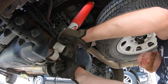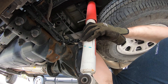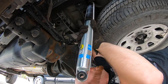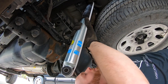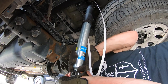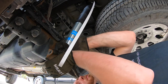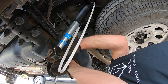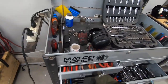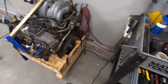The back shocks are super simple — they're just two bolts: one on the bottom that has a nut and bolt, and the one on the top you don't even need a wrench to back out because the nut is actually welded onto the frame, so just one 21mm socket and you get the job done. I actually kind of liked the red and white look of the Rancho shocks because the red ties in a little bit with the AT4 theme. But now the black boot of the Bilstein just kind of blends in, so it gives it a little bit more of a stealth look, which I kind of like.